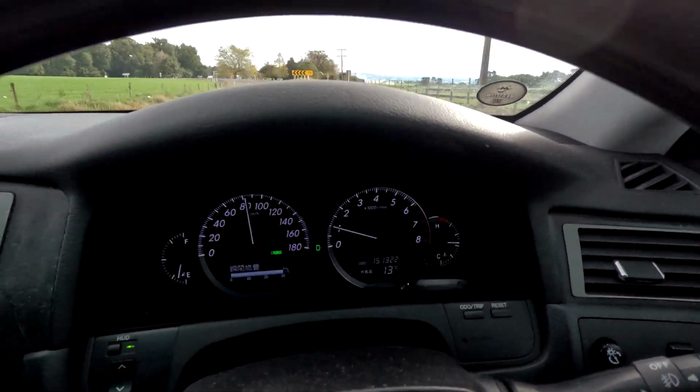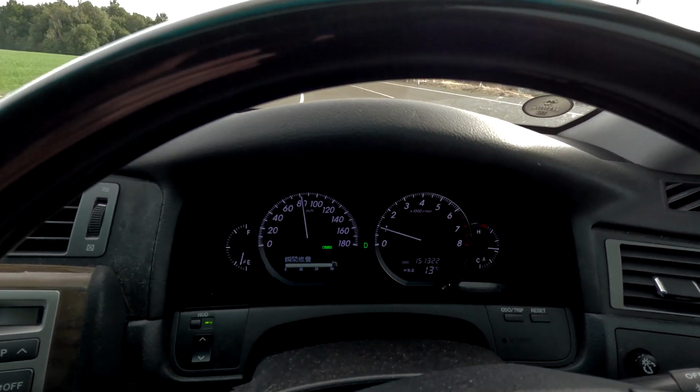Just made another little change. Sometimes with diagnosis, it's a matter of finding something that's good, doing some testing to find out how something good reacts. I've just put it into cruise control. On cruise, it's working fine. What I've done is I've just popped that speed signal from the dash down to the ECU, out of the ECU. Still measuring it over there with my scope, and looking at the scan tool, definitely no vehicle speed showing in the computer.